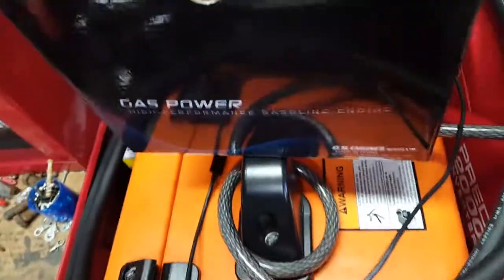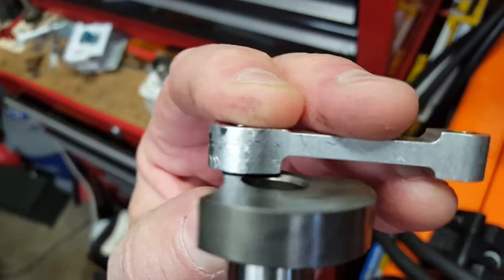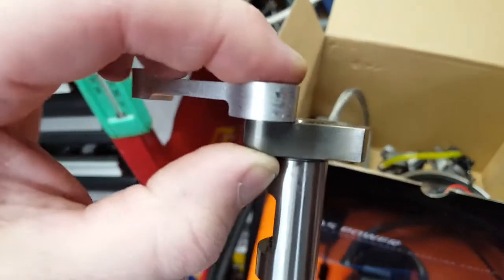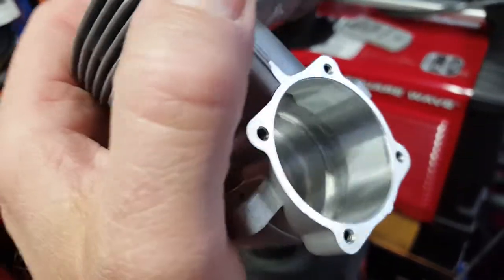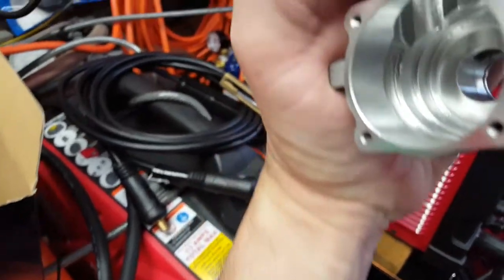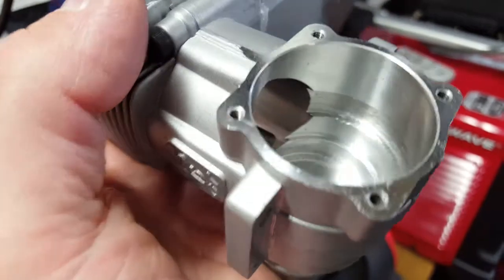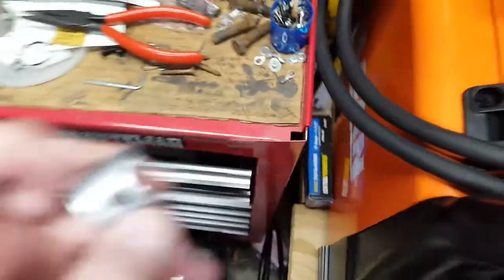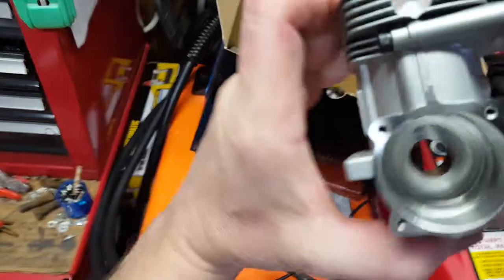Here's where the issue was — the connecting rod. I don't know if you can see how galled up that is. What happened was aluminum chunks wedged between the connecting rod and the crankcase. It had somehow wedged itself in there. I had aluminum shavings in the bottom of the piston, aluminum shavings on top of the piston, and a whole slew of aluminum shavings wedged down on the bottom.